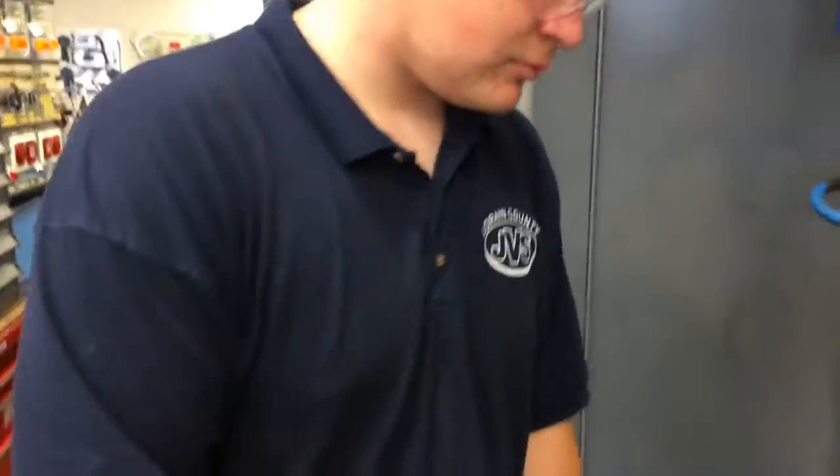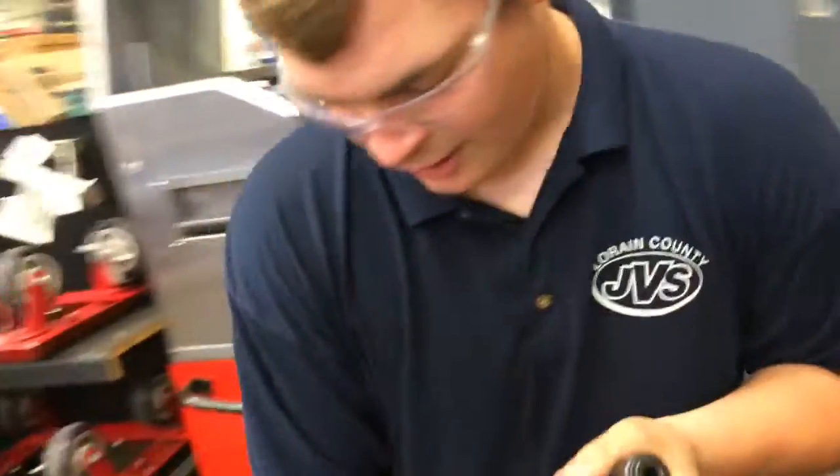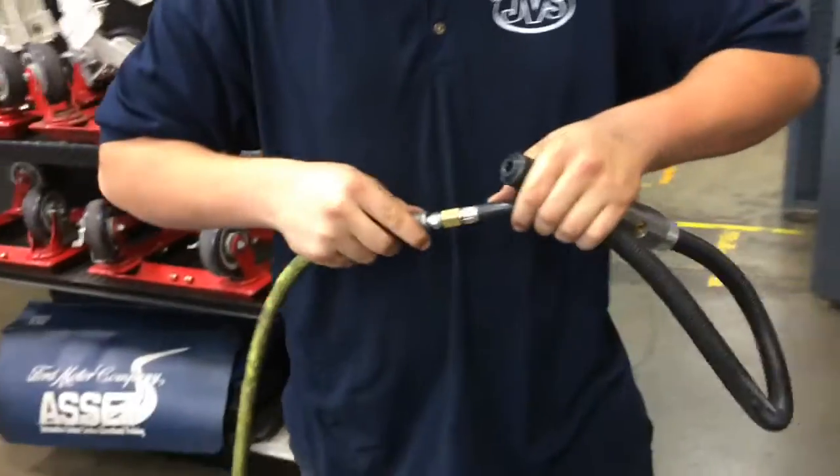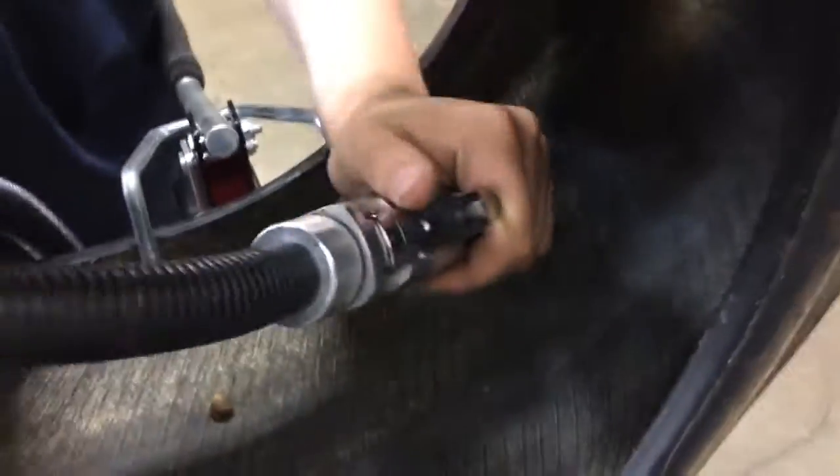This is your tire tack — I'm going to use that later. This is your drill. You're going to grab your drill. It's kind of like making a hole — if you have a nail in a tire, you come in here. You want to open it up wide enough for the patch to go in there. This is your drill; you're going to just kind of coil that in there.